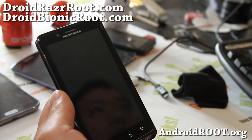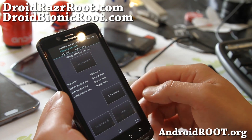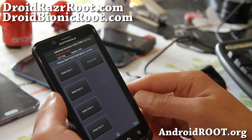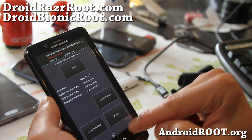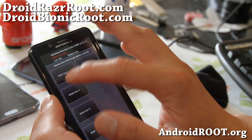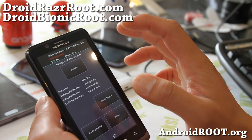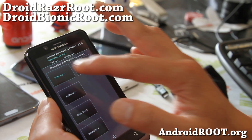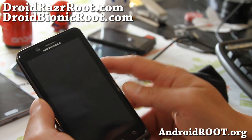Please do not try this on other phones. Go to dual boot options here. You can delete a slot if you want, but you also have to set it. I'm going to go to stock ROM and activate it — this will now boot my stock ROM. If you need more space, you can delete a slot here. Once you have a slot active, whatever ROM you install will go there. Leave the stock ROM alone, and if you want to install another ROM, add more slots or activate a different slot and install.